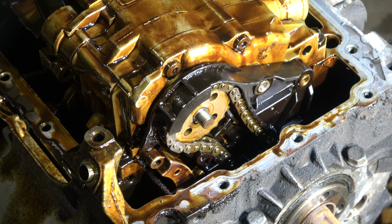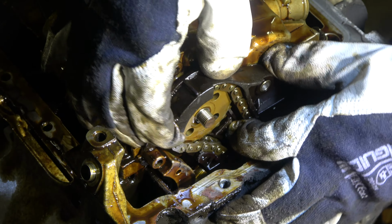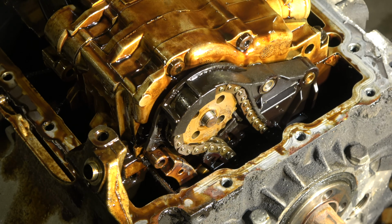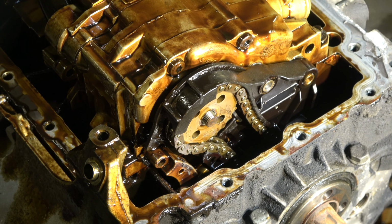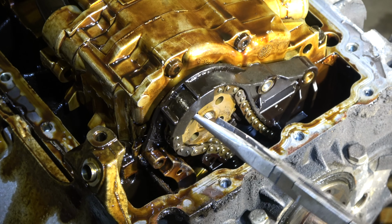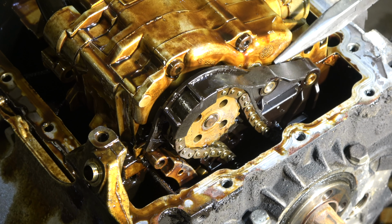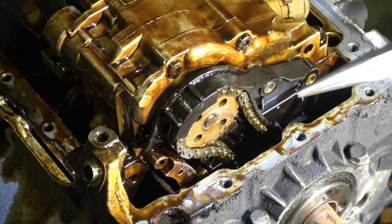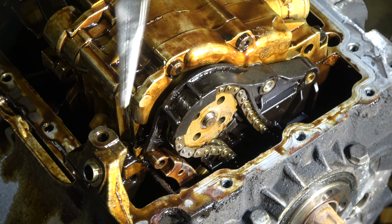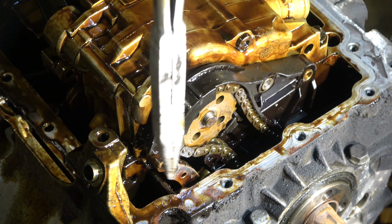Now when the central bolt is free, I can carefully move it. There is a tensioner, and I can move this central sprocket in this way and take it away. If I have good pliers, this is easier. Okay, now I have longer pliers, and I carefully move this central sprocket. Remember that this outer part damages really easily, and there is a tensioner in here, this part.